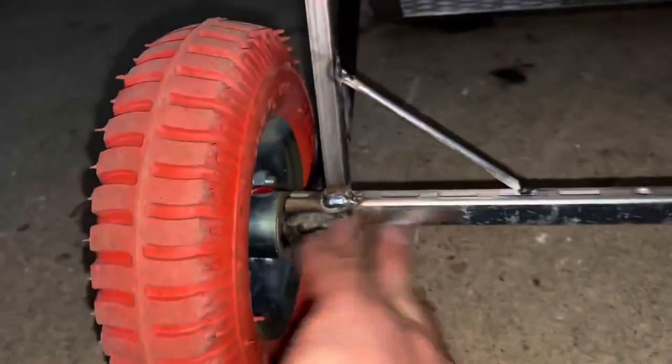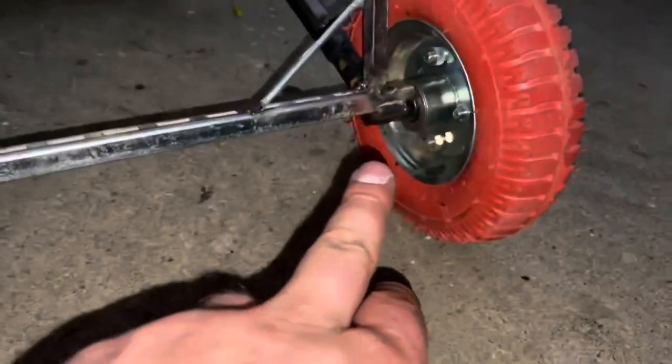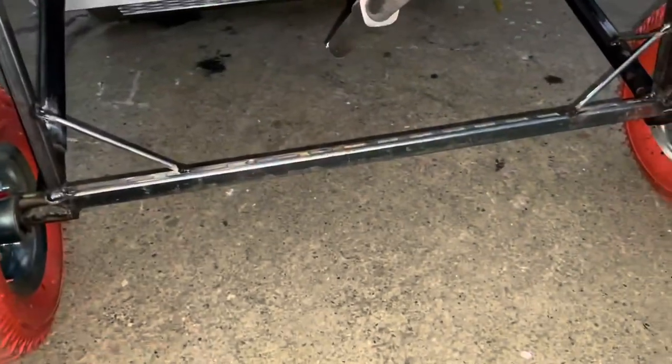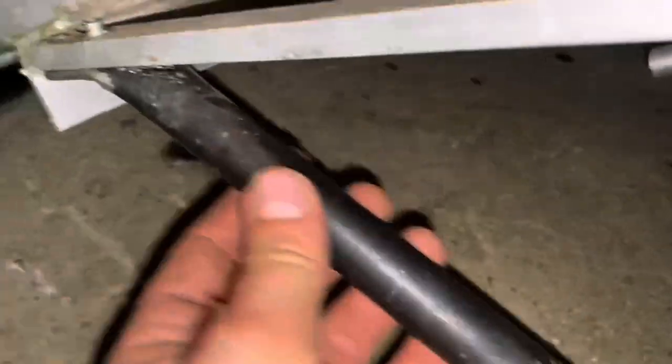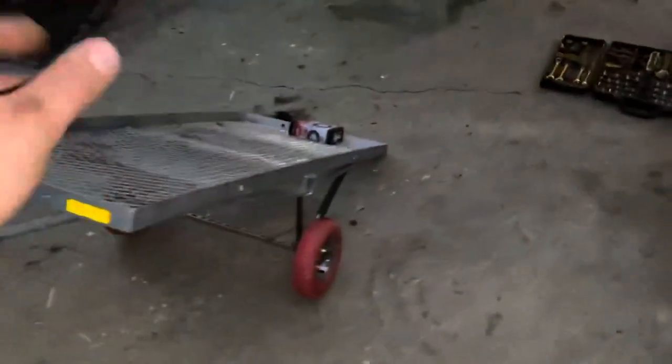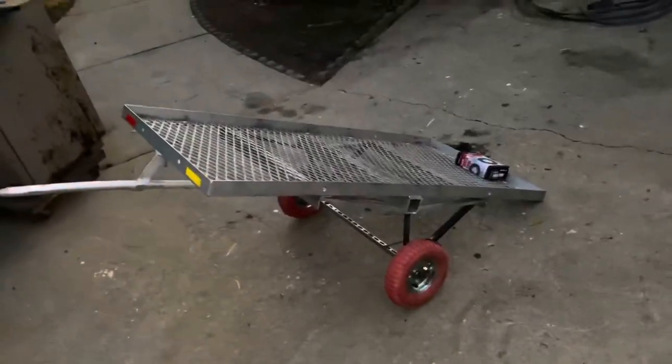What we have is a couple axles welded on either side to this piece of metal. The axles came out of a mower front end, again, something we recycled. So it's pretty simple, just a couple pieces of square tubing, some round tubing that I bent flat and bolted to the bottom, and a couple triangulation points there where I've just added some support. This trailer, I want to mention too, it's good for 50 or 100 pounds.